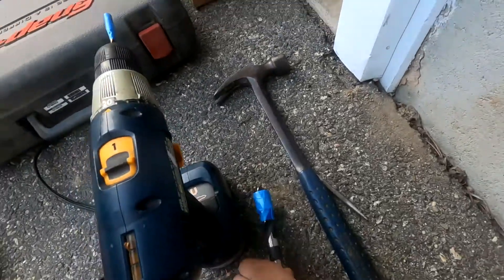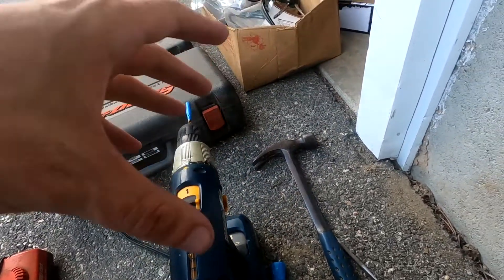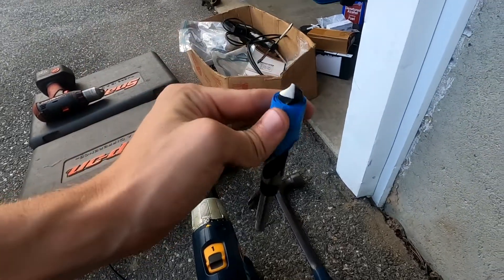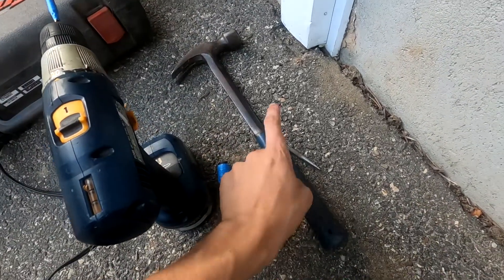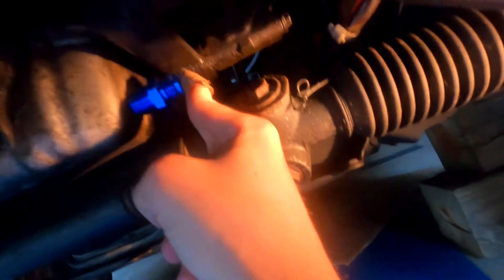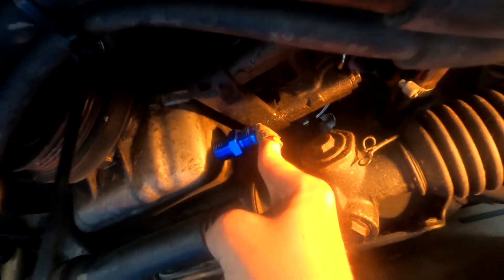Now we are at possibly the scariest part of turboing a Miata — and I didn't think it was that scary until I watched all the videos telling me how scary other people thought it was. It's time to drill the oil pan. You need to drill into your oil pan with a pretty big bit to tap it for a fitting, and the oil pickup is basically right behind where you need to drill. If you go too far, you run into that, need to pull the pan, buy a new pickup — it's a bad time. My dad is coming down to help me, so I have another set of experienced eyes to make sure I don't screw it up. The first thing we need to do is center punch where we want to drill. It is hard to clear that steering rack there, and I did zip tie up my AC lines to give me some extra room.